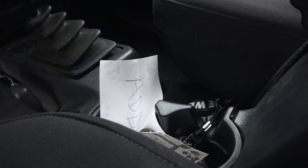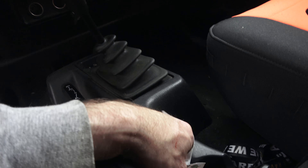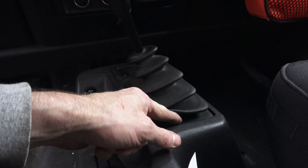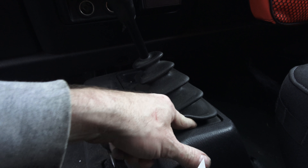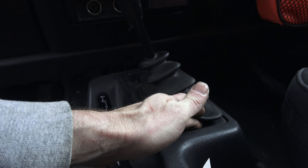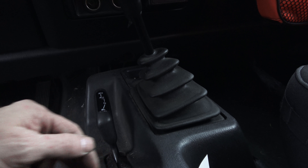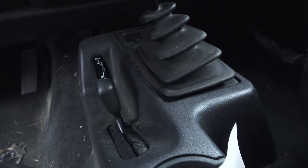We're rocking. I did notice one thing when I pulled it out — this was the first time to actually drive it. Here's a good tip: add diff oil with a key stabbed into it, so whenever we drive it, we know I need to finish checking diff fluid levels. I wanted to do a final check when the Jeep was actually level — that's why it's there, so I don't forget. When I go into full reverse, because of the body lift, I'm hitting the back end of this shift boot. I hear that's a problem a lot of people have, so I may go in and trim underneath the boot a little bit. It goes into reverse fine — you can just feel it touching and you have to give it some pressure until it grabs the gear. So far that's the only problem I have. I haven't really experienced an issue with 4Low, which is also a side challenge some people have after a body lift, but I'll test that out later.